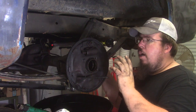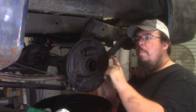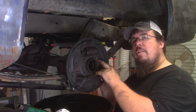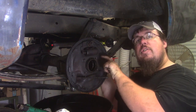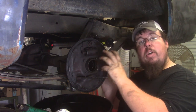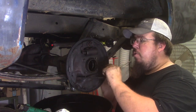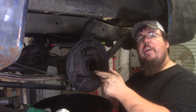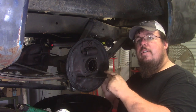Moser Engineering has on the instruction sheet to cut this down to 1/8 of an inch, but I did some measuring, and with the backing plate, the way the backing plate is set up on this axle, that 1/8 of an inch isn't going to give me enough of the snout for the bearing to properly seat on the C-clip eliminator bearing to set up. So I'm going to do some measuring to make sure how much I actually have to cut off. It's going to be a little bit thicker than 1/8 of an inch,